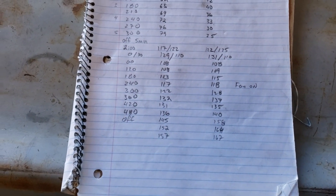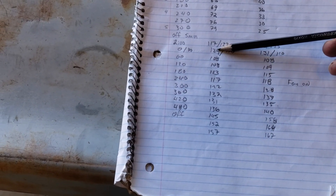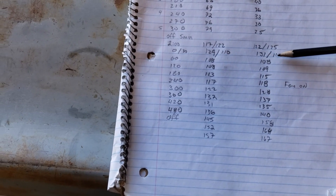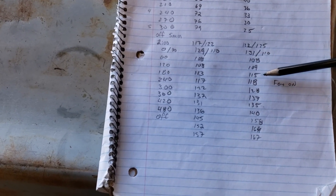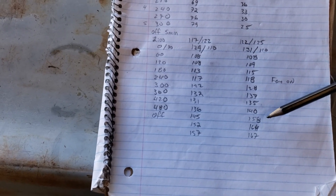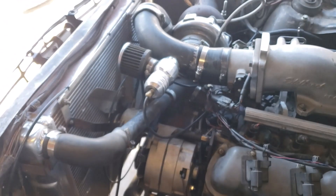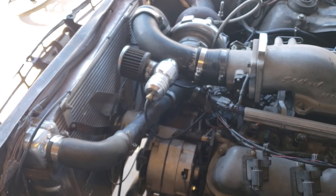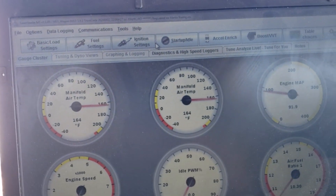So you can see from when I restarted it: 129, 131 — 30 seconds later it pulled 20 degrees out of the air, just about right, cooled down, and slowly kept creeping back up. They both match fairly well within five or so degrees even when we turn it off. Back here is when the fan turned on — this is where you start getting the increase because the fan blows pretty much right into the turbo inlet. So we're at 171, and the intake manifold is showing 164.